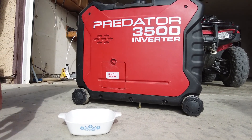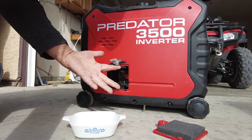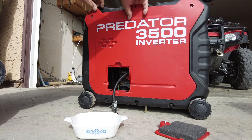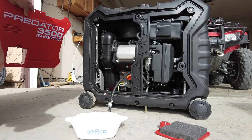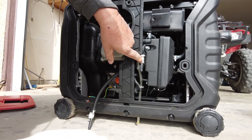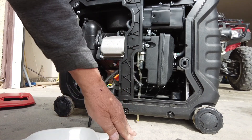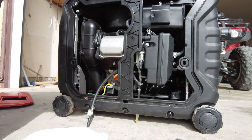On the side here there's a little door for checking the oil. What I've done is I've added a quick drain here. I'll pull this panel off so you can see. I don't have to pull this panel off to drain the carburetor, but I'm going to pull it off to show you how I did this. This comes off pretty easily — I've already taken the screws loose. The carburetor is here and the screw underneath is a drain. What I've done is turned the screw open so it's open all the time and put a rubber cap on it so that it doesn't leak fuel.